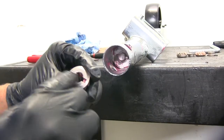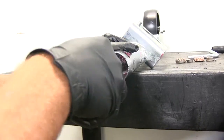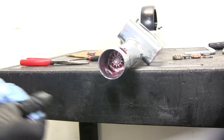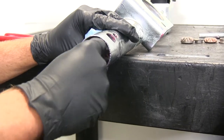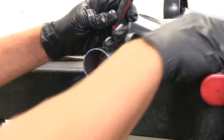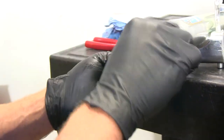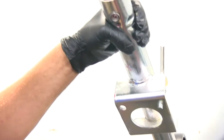We're going to grab our screw gear — that's the one that is enclosed and needs to slide onto our pin. Make sure it fully seats down so the top of the screw is flush with the top of the gear. If it doesn't seat like that, just rotate it until it goes onto the pin. Then the side tube spacers — get those slid in. The one that's more rounded uses a little friction to hold it in place, and we can use our punch to seat it. There's a little flat spot on it — make sure that's facing down towards the bottom of the jack, towards the wheel. It should just pop into place.